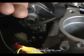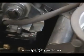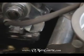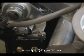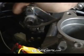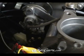try to zoom in here a little bit more. See that? See that roller? Now this is working pretty good. It's coming out of contact with it when it's sitting here and you haven't got the bike started. That's because the throttle plates don't respond very well till the bike starts. Then it keeps right up with it. Let me go into diagnostics and you'll see that.